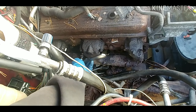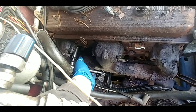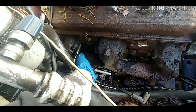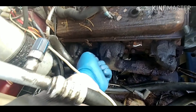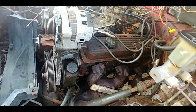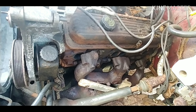This is why I don't like pinstripe or anything — it just holds in moisture. You can feel the rust behind that; I'm gonna have to get that taken off. On the donor motor yesterday, I got both alternators off, the fan belt off, and I soaked down the manifold bolts real good. They're gonna be real tough to do — I'm not sure how I'm even gonna get those off. I might have to break them, cut them, something. We still got motor mount bolts, fuel lines, the rest of the wiring harness and all that.